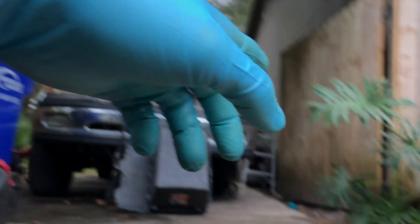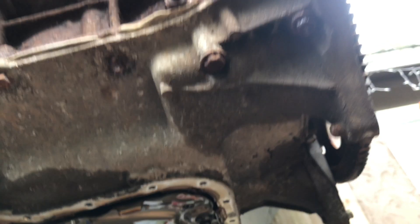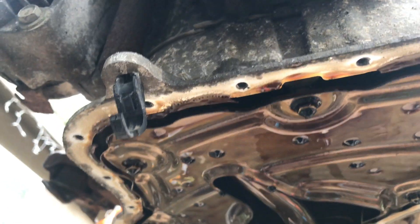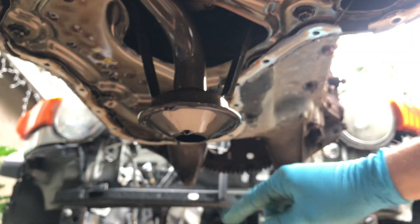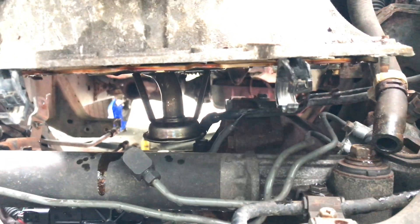There's a dipstick there — if you're ever above the dot it looks like your oil line is above the baffle. The pickup is right there, and I'm going to test fit the engine again just like this to see how it fits and if there would be any room for a modified oil pan. At this point I don't think so. I thought maybe I could just spin it around and reverse it, but no — you need a longer pipe that goes all the way back towards the rear to get in between the crossmember and the diff.